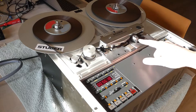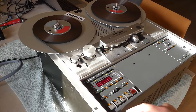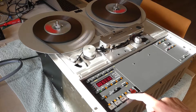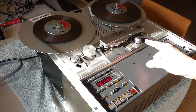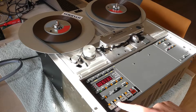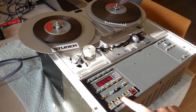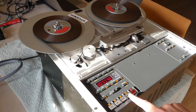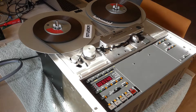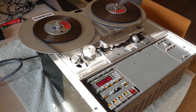Also a nice feature is the pinch roller. As you can see, the pinch roller is very close to the capstan, but when you wind it retracts a bit more. At startup it needs to travel a long distance, so after a wind you can already put it in a sort of ready state — you can click it here and then the startup is very instantaneous, as you can see. There's almost no audible tape speed startup.